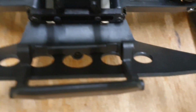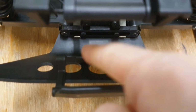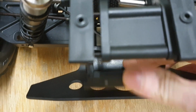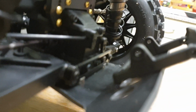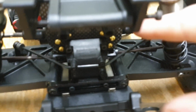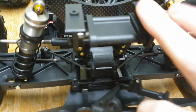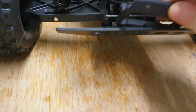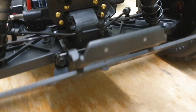Now I could just cable tie a loop over that one, and then a loop over that one, put a hole here and here, and then loop it across there as well. And that will hold it pinned down, but it won't stop it from doing that as much. But then you've got these little loops here on the side there. And I'm thinking to use this metal bar going through the wing mount, put an M4 rod through the middle, and then I can put links from this piece down to this piece, and then that'll hold it like that and put the resistance I want, because right now it's not got much. Obviously it wants some give, but not that much. And I think that might be a cool idea to get a wheelie bar, if you can follow what I mean anyway, but hopefully it works.